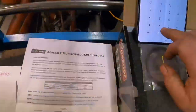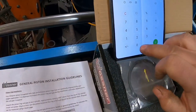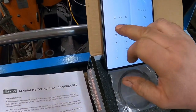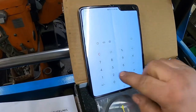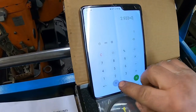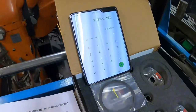So the top ring would be a gap of around 16 thousandths of an inch, and the second ring needs to be a gap of around 19 thousandths of an inch maximum.